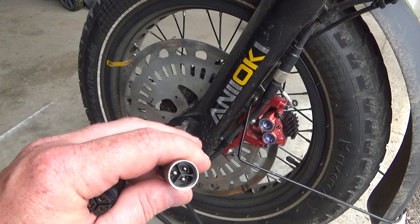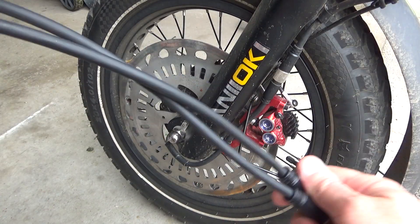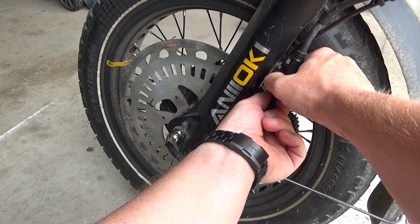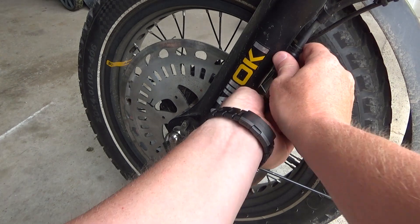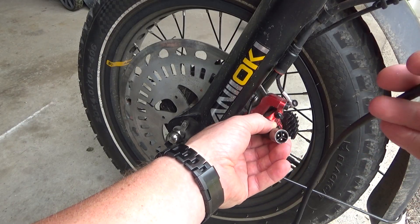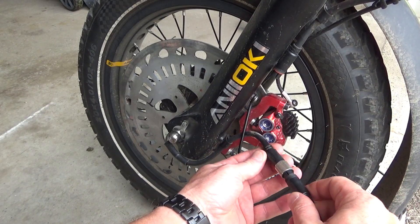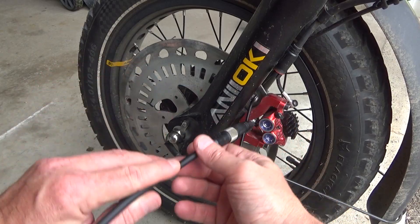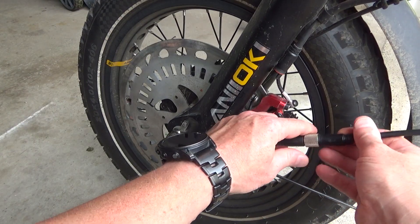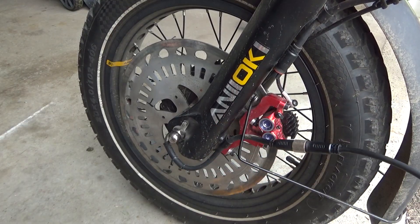That's why I really recommend — I would say it's a must-have cable for proper diagnostics. So what we're going to do first: unplug the wheel and connect our cable to that plug. Make sure you line up the arrows on each of your plugs — they have arrows here and here that line up. For diagnostics it's not necessary to tighten all connections; just plug it in like this.